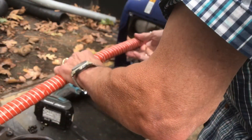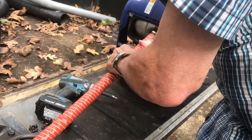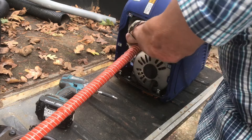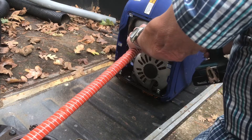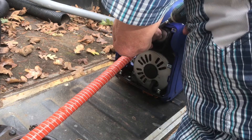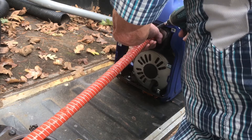I'm going to be putting this hose on. There's a hose clamp on it. I get it up all the way over that spark arrester screen, and then I tighten it up with my cordless screwdriver — a little, needs a little bit more.